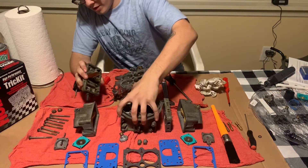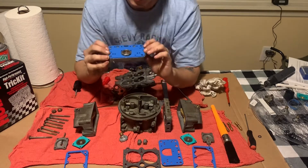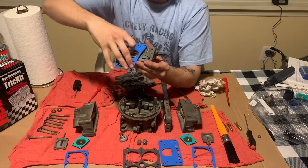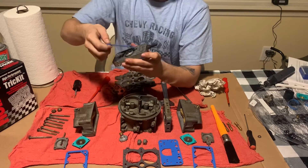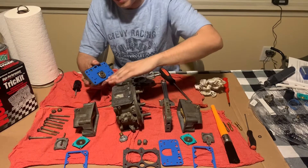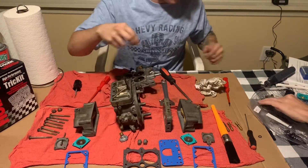From there I'm going to locate the gasket that goes on this side, which would be this gasket right here. To know if your gasket is on the right way, there are these two little pins here that will fit in. So if I put this on backwards like I originally did, the gasket's not going to fit on — one side will, but the other one will not. You're going to want to put that on the right way. I want to verify that we've got a good surface. In the last video we took a Dremel and a wire wheel and just lightly went over this surface to make sure there was no residual gasket stuck on here. Make sure it fits flush before you start putting your screws in.